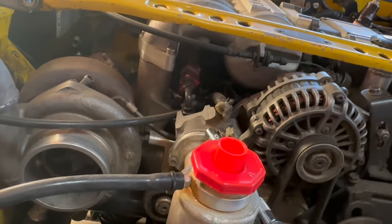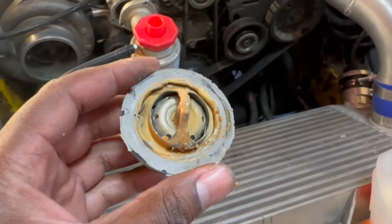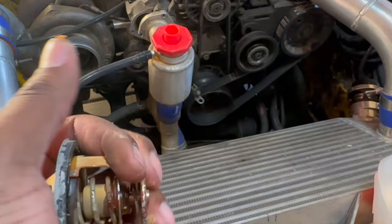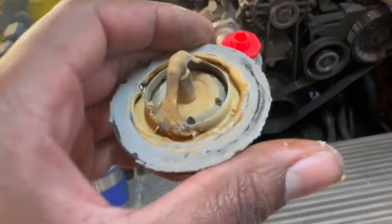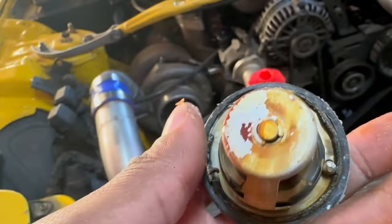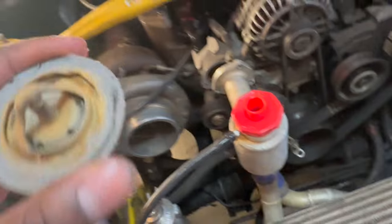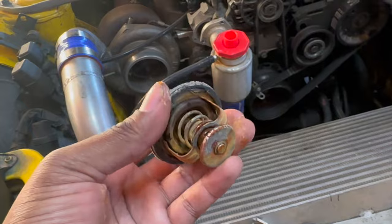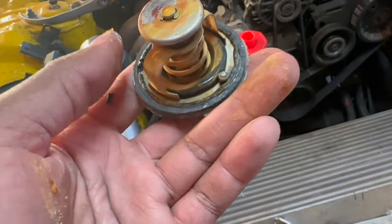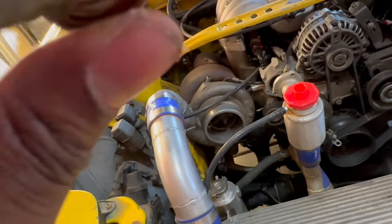Let's see what's going on under here. I probably got to use my hands for this one. So this was like stuck in there. This moves pretty easy. We'll do the hot water test with it, but the seal is definitely dried out on this bad boy, which is probably why they put the RTV on there. Which is weird because on the invoice, they charged him for a brand new thermostat — but maybe they didn't replace the thermostat seal. This isn't good.